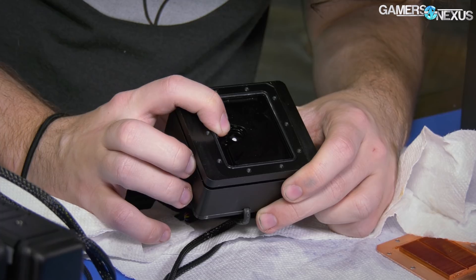We got the job done and it worked fine — there's no pump noise and it's technically cooler than it was. Another thing we considered but didn't do was filling through the cold plate instead of the side screw holes. The concern was how much additional fluid you'd need to fill the bottom chamber before closing it off with the cold plate, and with one set of hands making sure you can get the cold plate back on without spilling any coolant. But I think it probably would be easier to fill through the cold plate next time, because then you can more easily get all the coolant down the tubes into the radiator, close it once it's close to full, then pull the screw off the side and fill the rest through that port.